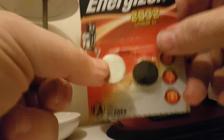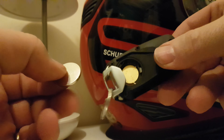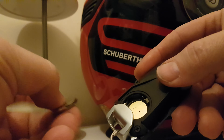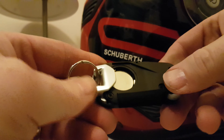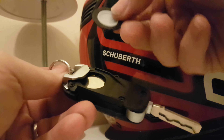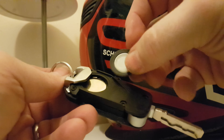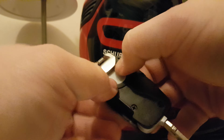A CR2032 battery is around 4 to 5 pounds from a supermarket — probably about 6 dollars — for a pair. It's just the empty cavity. Remember to put it in the same way up, with the writing on the top and the plain side on the bottom. Poke it in, give it a little push — there are no clicks, it just goes in. Get your nice little rubber seal; remember it was that side up, that side down. It's easy to tell the difference so you can get it in first time. Give it a little push to make sure it's seated home.